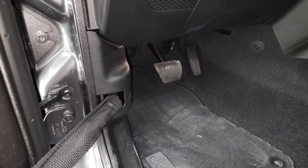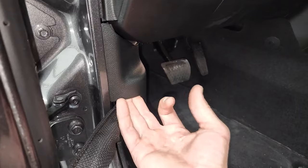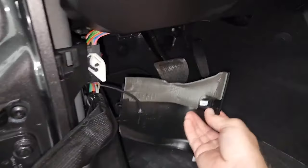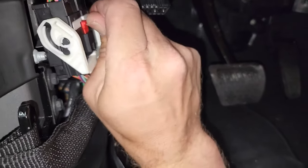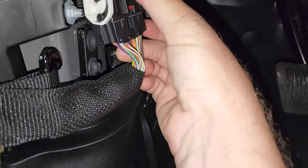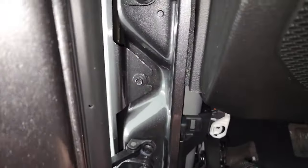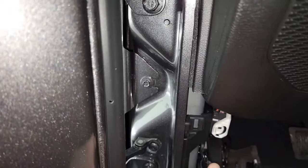The first thing you're going to want to do when taking off the front doors is there's a plastic piece right here. Get your fingers in there and pull it towards yourself — there are two clips and that'll come out just like so. Next, there's a red safety right here; push that up and then there's a black button right there. Press that down and you can put that up, and it'll push that wiring harness right out of there.